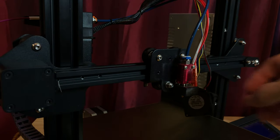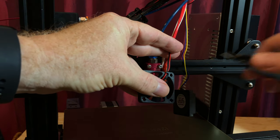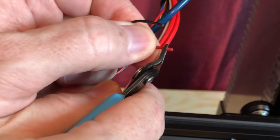Now these two fans are just hanging here. I'm going to work on the hot end fan first since I actually want to replace it. I want to preserve as much length as I can on the leads, so I'm going to cut them off flush with the body of the fan. The old fan is now officially retired. Then I'm going to use the flush cutters again to strip about two millimeters of insulation from the leads. A lot of times crimp connectors will work without doing this — the crimping process forces the metal to curl over and grab the wire, usually forcing its way through the insulation. But sometimes the insulation is too thick or the crimping force isn't sufficient, so if you don't have a lot of practice crimping, you'll get a better result by removing a little insulation first.